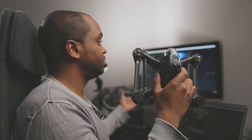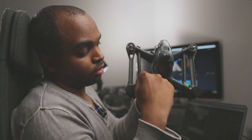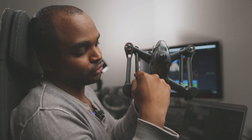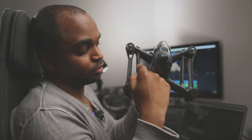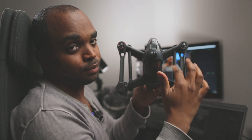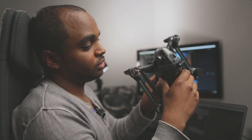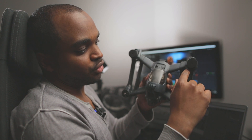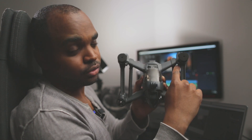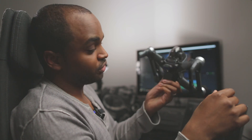Hello, this is Bruno from the future. I was finishing this video and there's something I remembered — I never told you how to install them. If you need to install those arm reinforcers, you need to put them on first, because if you already have the original arm bracers on, you won't be able to install these ones. One last thing: there's no screw threshold — you just need to clamp them. And that's all there is to it. Cheers guys.